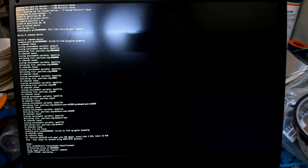I'd probably just use the 128 gig card as a boot device, but then SD cards are slow, so I might need to pop that 64 gig out and just write the raw image that Fedora provides for ARM64 to that eMMC and then boot from it, if I want to boot from an eMMC, that is. All right, for the extreme purposes of just demonstrating how this works, I am just going to write it to an SD card and boot Fedora, and that'll be it. But for my own purpose, I will later on remove the eMMC, write Fedora directly to the eMMC and boot